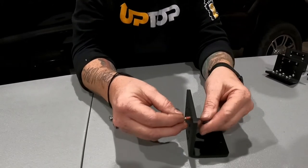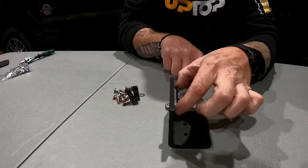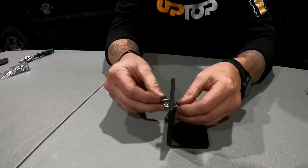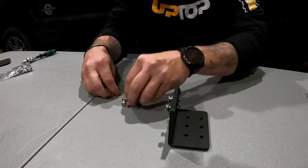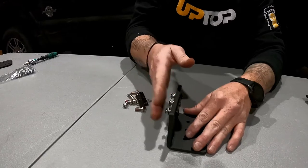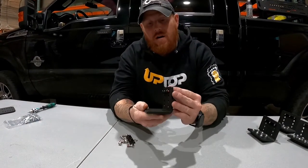I'm going to line these up. The upper one that connects to the EX goes to the inside of the L. Each one needs a bolt and a lock washer, and you want to leave these loose by hand so that you can slide the load bars right into place. That's your top section — that's where you'll actually attach to your EX.